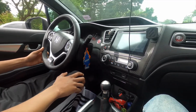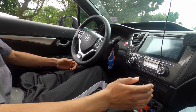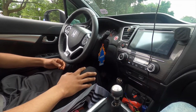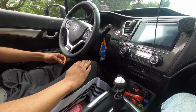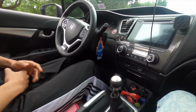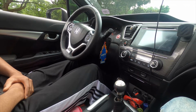All the way back in, put the car back in neutral. Right. Okay, good. Neutral. All right. So you see how you just did that? No gas whatsoever. You see what I'm saying? So that's what we got to do. You got to start moving the car first, just like that. And then you're going to start applying the gas now slowly. And as you're applying the gas slowly and the car is moving a little bit better, then you come off the clutch completely. Okay. So we're going to practice that right now.